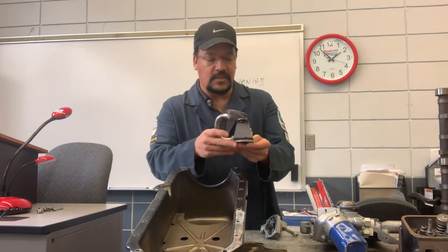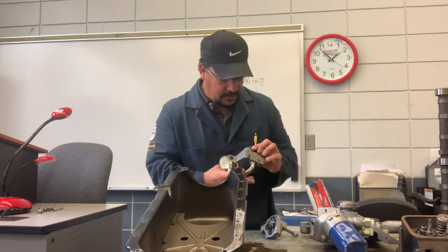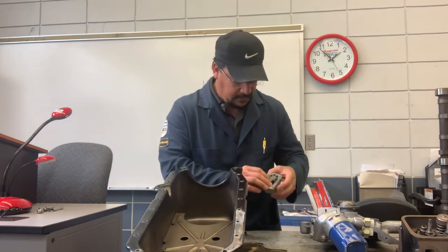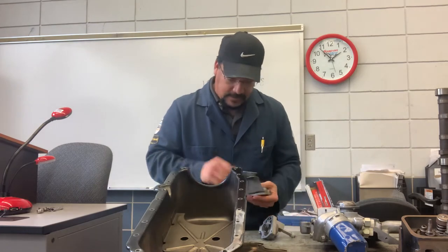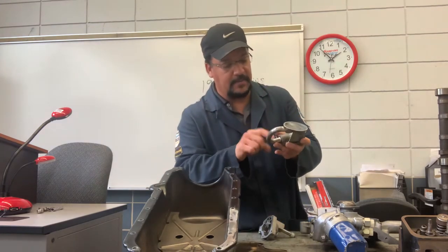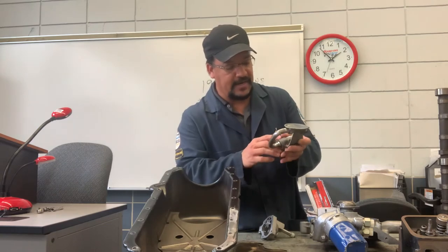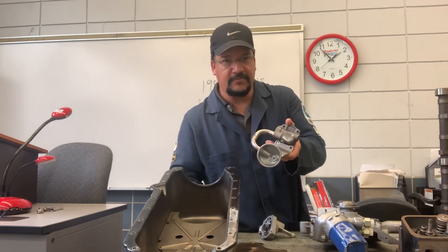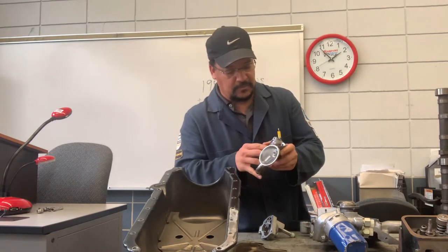This is the oil pump itself — this is, of course, gear driven. There are gears inside here that drive it. This happens to be the screen part in the neck assembly, which can be removed by the way. You can put it on a vise, take this off and remove it if you need to clean it. But look for any debris that are inside the filter screen, as that can cause some problems.